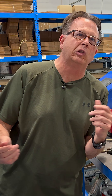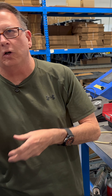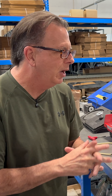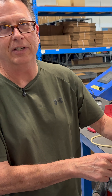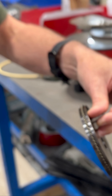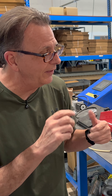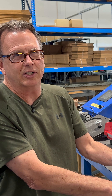What we've got here is a ring tangential load tester. When we hear the words high tension, low tension, things like that when it comes to rings, what we're generally talking about is the oil ring tension — how much force is that oil ring putting against the cylinder wall. We can adjust and check that on the compression rings as well, but on the oil ring, this is the largest contributor to friction in the engine.